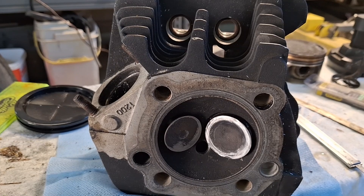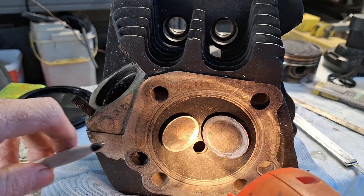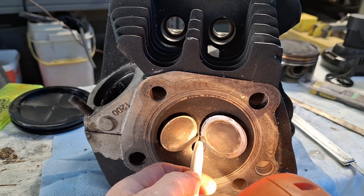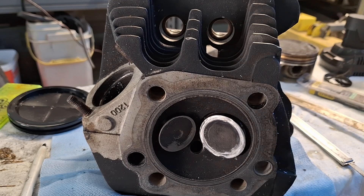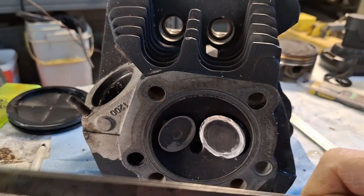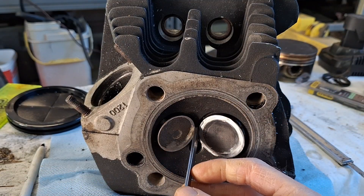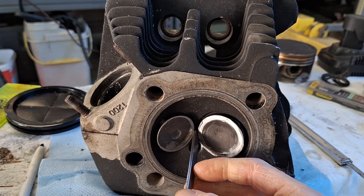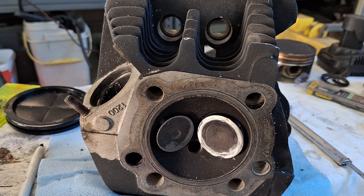At that TDC lift position, what you're looking for is the clearance between both valves right here. You need at least 80 thousandths. I've stacked some long feeler gauges together measured at exactly 80 thousandths, and you just slide them down in between the valves. You've got plenty of room in there to check that clearance.